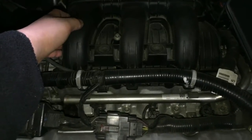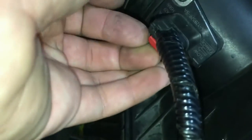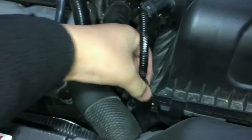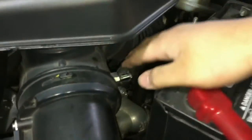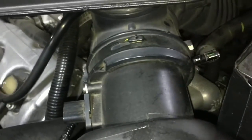Three are here and three are in the back underneath this. You're going to go over to your air intake sensor and you're going to want to pull off the connector for it. There's a little red tab — you pull that towards yourself, you pinch the bottom. It should come off smoothly, and now it's disconnected. You're going to disconnect it off your main and then you're going to come over here and disconnect one of the hoses.